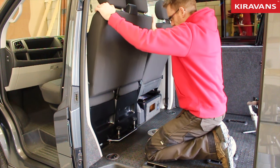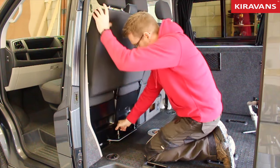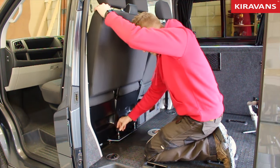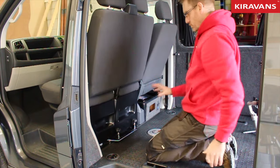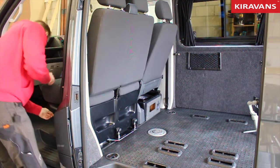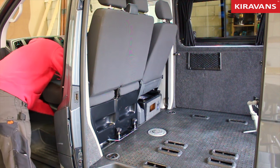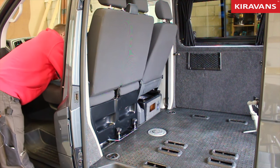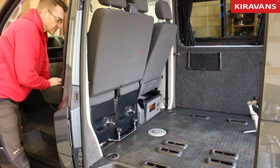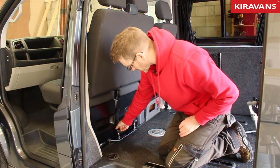And then when it comes to locking it, line up the top plate with the bottom plate, release these two bolts from their upper position, do a little bit of a wiggle to get them both engaged. Now, I wouldn't put those in tight just yet. When they're engaged, then come round to the front and do the same with the front ones. And when you've got all four engaged in their positions, you can tighten them down and then come around the back and just tighten these down.